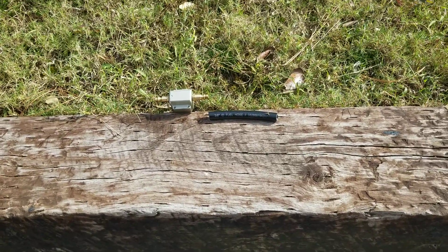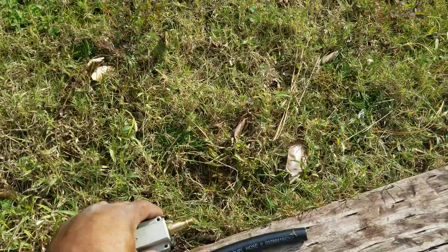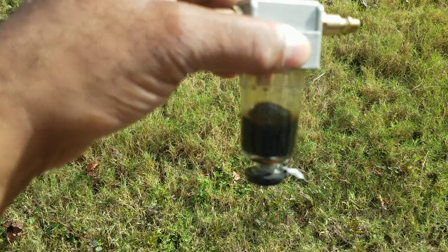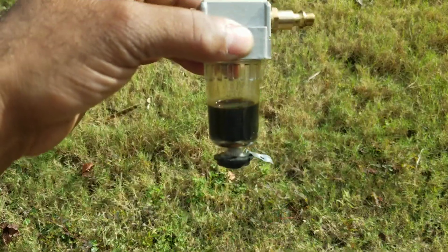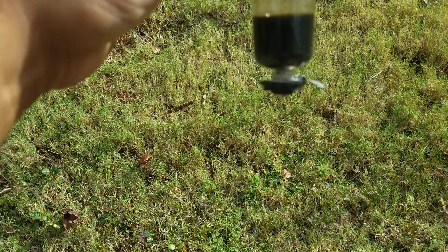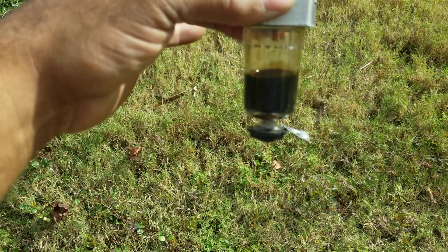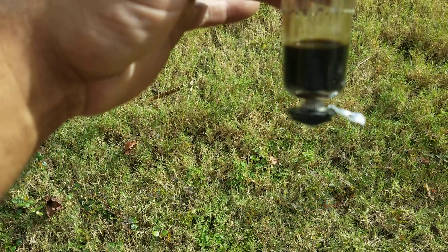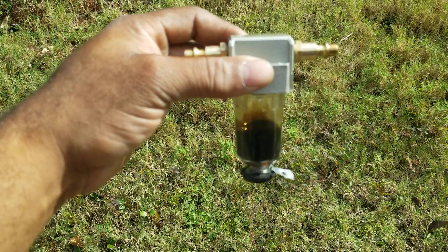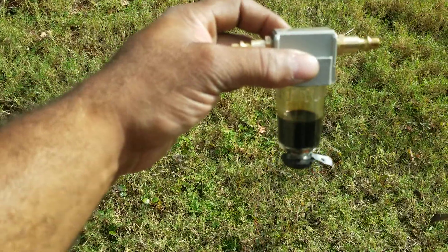What up YouTube, I'm back again, it's a bright beautiful day today. My little tank thing that I made is working well, and if you see that little metal clip on there, I had to make an adapter because it did get to a point where it was leaking air, so I had to squeeze it down a little tight. I just made a little adapter to go in there for now — I'm going to replace that, that's why I took it out today. It is working, it's catching oil fine, and it hasn't thrown a check engine light. The car runs smooth like it's supposed to.